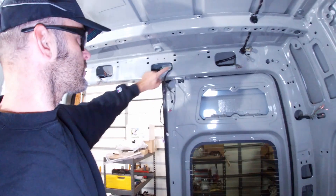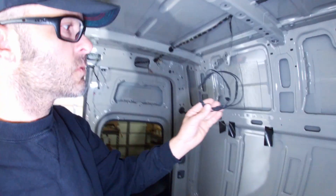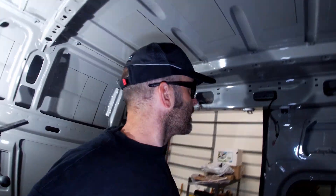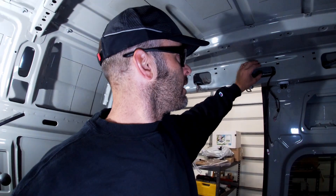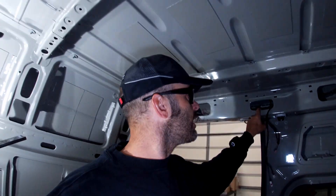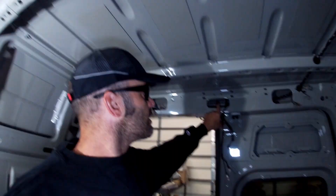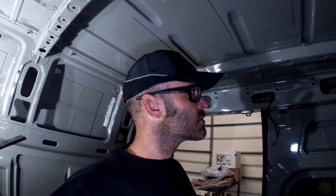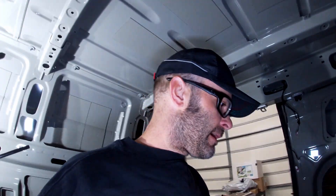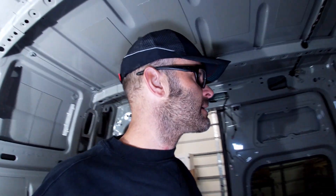I always put a factory rear light back in here — not the one with the switch. I take that wire and run it back into this area. I like a factory light right here so that if there are any issues with the backup camera or the rear brake light up on the high side, you can just pop out this factory light just like a normal technician at Mercedes would do, so we're not permanently covering that with anything.